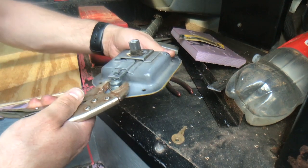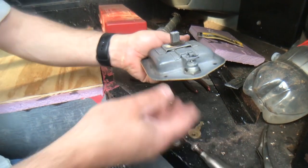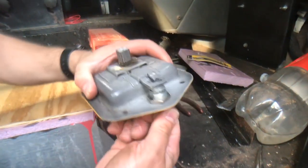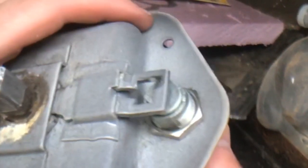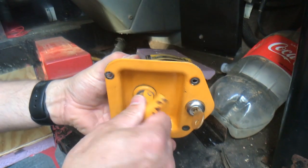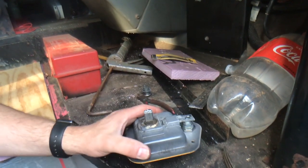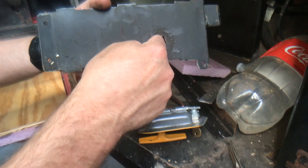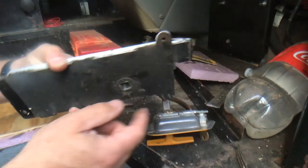You don't have to go super tight with it. Let's test it and see if it works. Look at that — it works! It turns the tumbler, pulls that pin away. With that pulled away, it allows us to turn this as much as we want, and that drives the steel bar in or out to lock into the other side of the door.